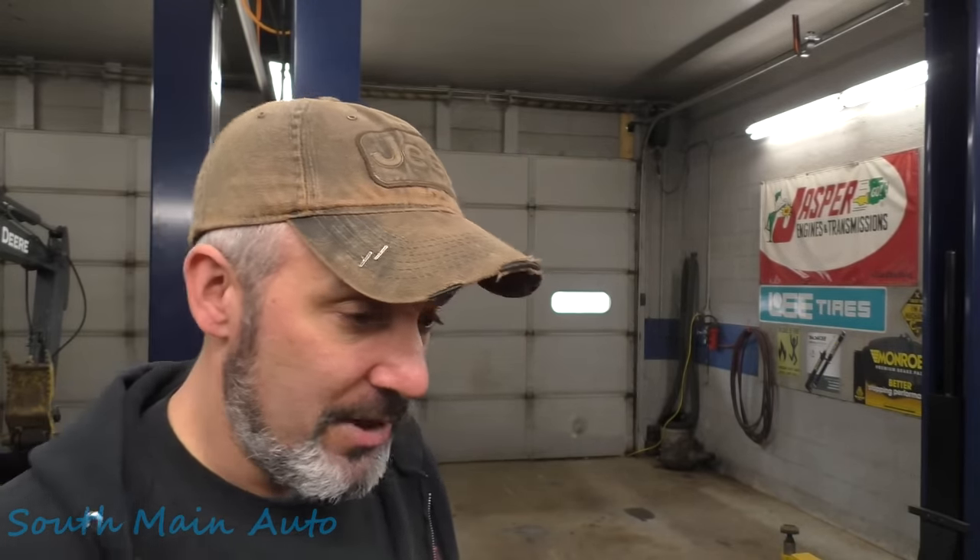Let me go over and see what's going on. According to the fellow — I spoke with him before — he said it was doing the same thing, like it wouldn't light up, no communication. He said he was going to change some relays and do some stuff under the hood, so I don't know what he's done. I was pretty definitive with our diagnosis last time — it was the run/start relay, and we were losing power to a group of fuses. We're going to start right with our same diag and tread it backwards — did we just disturb a connection by messing around in there?